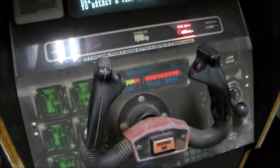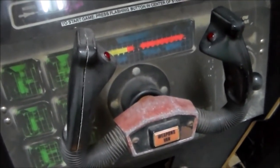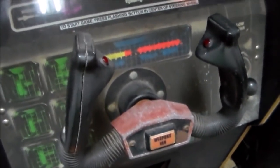And so basically, we weren't getting any sound out of our left speaker. And I had narrowed it down to, I thought it was the audio amp. So on the actual board, we had ordered new audio amps, and we went ahead and soldered those in whenever they came in. And it did not fix the problem. So after looking and looking,